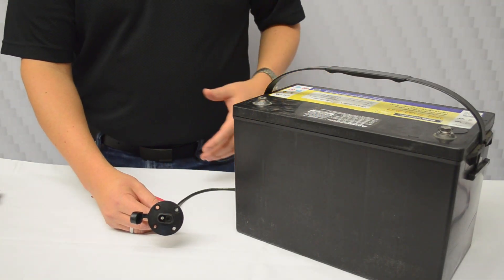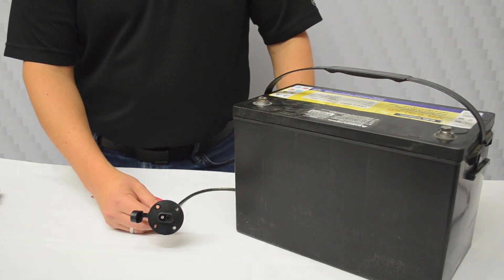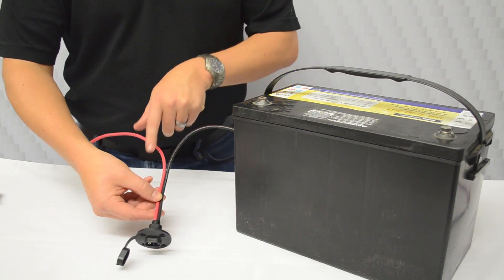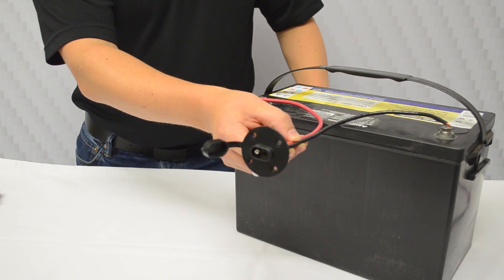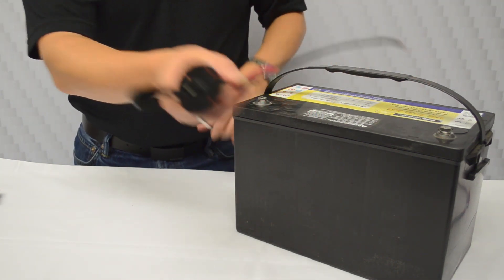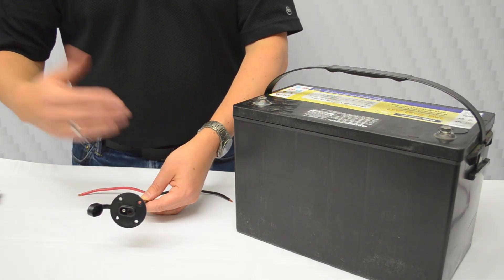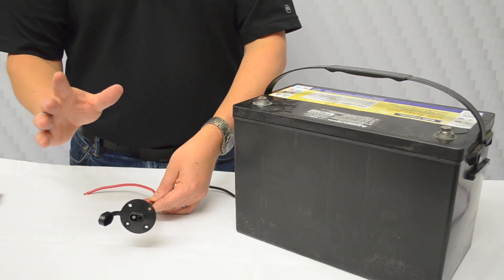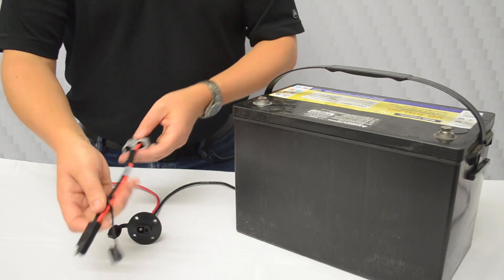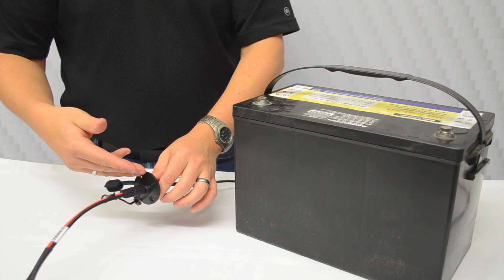I wanted to show an example of what's happening with the RV pre-wires and how you use the adapters to connect the Go Power PSKs to any of the pre-wires on your RV from the factory. Go Power and Zamp both use the same connection — there's a positive and a negative wire connected right to the battery, with a longer run of wires from the connection on the outside wall of the RV back to the battery. A Go Power one will have a Go Power solar sticker; a Zamp will say 'Zamp only.' It's not actually the case — they're the exact same connection. You're not going to void your warranty by plugging another brand's solar kit into it. The adapter that comes with the Go Power PSK plugs right in, and now you're charging your batteries whether it's in the Go Power plug or the Zamp plug.